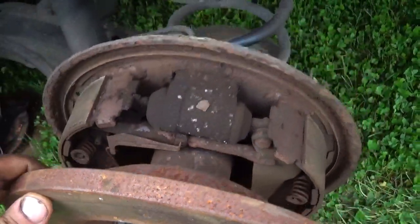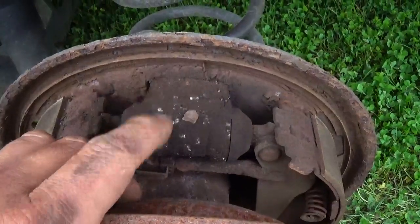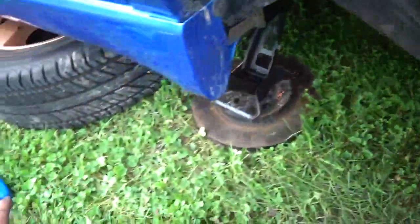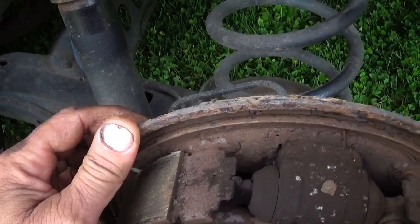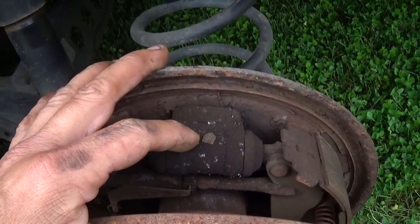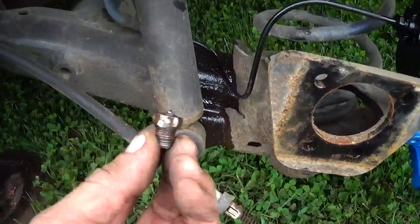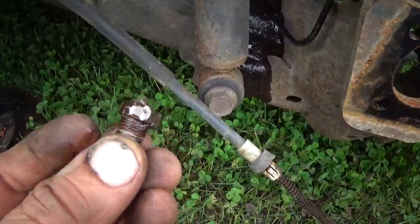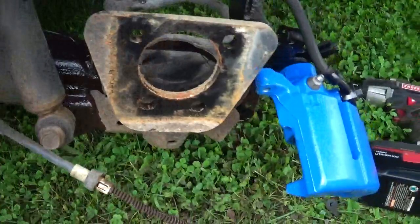Getting started: I'll take the shoes off and get this hardware out of here. I can leave the cylinder on the plate and then remove the brake line in the back, hurrying to get the new line on so the brake fluid I'm losing ends up in the caliper. Then I'll get the bearing off and the cylinder and backplate can come off together. Almost didn't get that line off — it was close to where I was shearing or rounding it off; you can see it started rounding. But we got it — line's on, bleeder is shut.